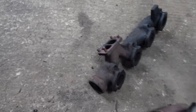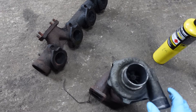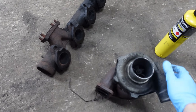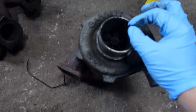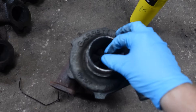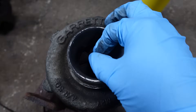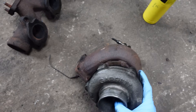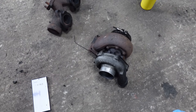Now this manifold was cracked, so Sam — Sam Cole, who deals with Fords and New Hollands based between Derry and Letterkenny — I have to give Sam a shout out. He had this turbo. Now I'll be honest, there's no longitudinal play — the shaft doesn't move in and out — but there is lateral play as you can see in the camera. With that we felt it would just be a better idea to get the turbo rebuilt.